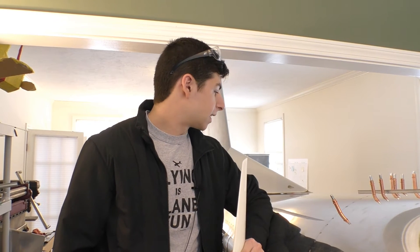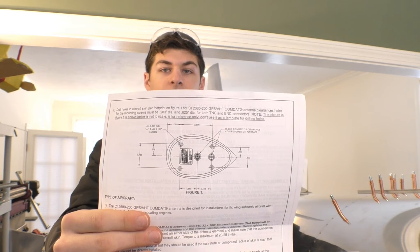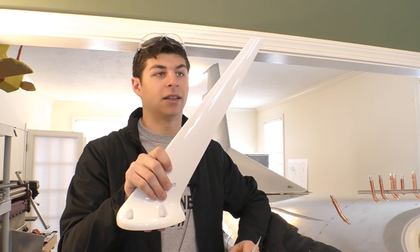I'm getting ready to install the Comant GPS and com antenna using the installation instructions provided by Comant. There's a diagram I'm using to figure out where the holes should go for both the connectors and the mounting screws. This is the turtledeck where we're mounting the screws through, and on the bottom we're putting a doubler that will have a line of rivets through the center, attached using the same glue that holds the side skins together. It should be a really strong structure given the leverage from this long antenna.